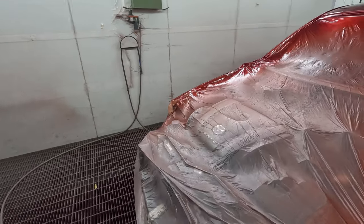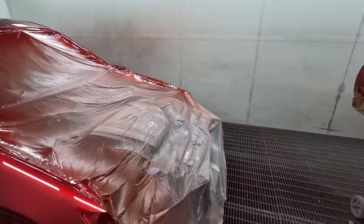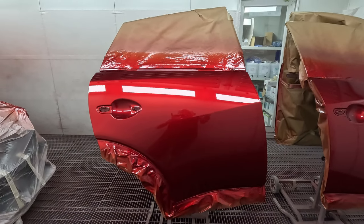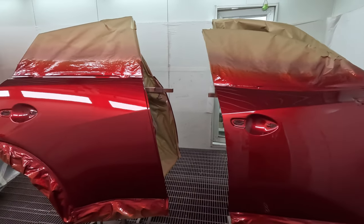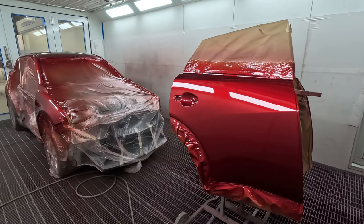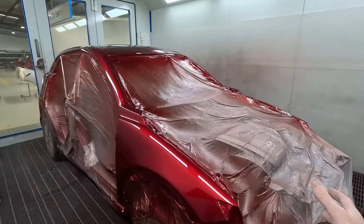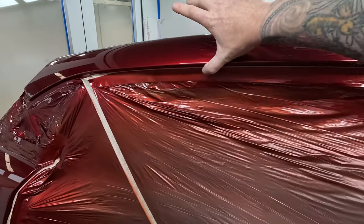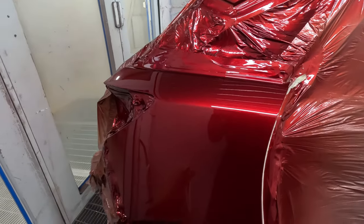And like I say, the most important thing is getting that candy thin down correctly. I was at one point mucking around with spray guns, settings, air pressures, distances and all that, but I was looking in the wrong direction because it was all in that candy stage. But yeah, some of the other things, they all do play into a nice clean job, and that is, there's no edge there at all. That's killer. That doesn't even need to be polished. That's awesome. Really good, really, really good.